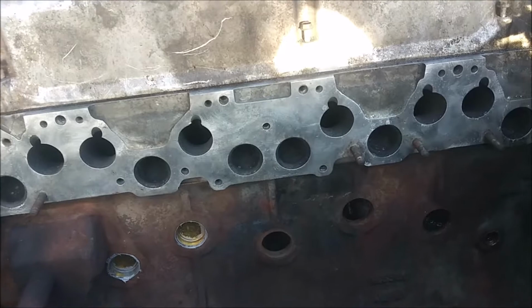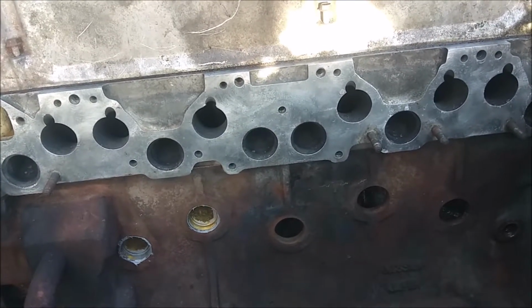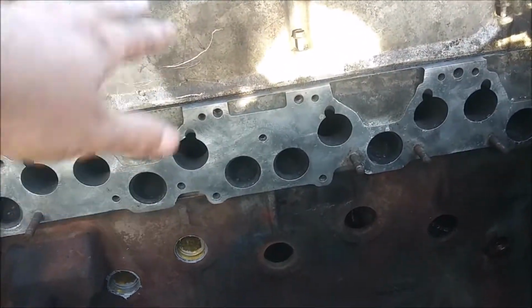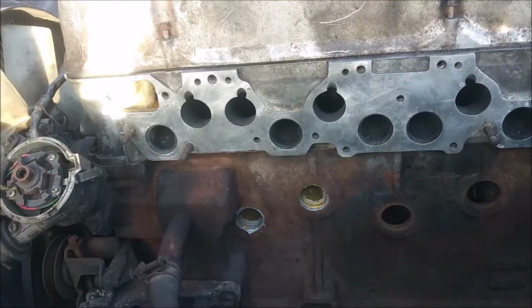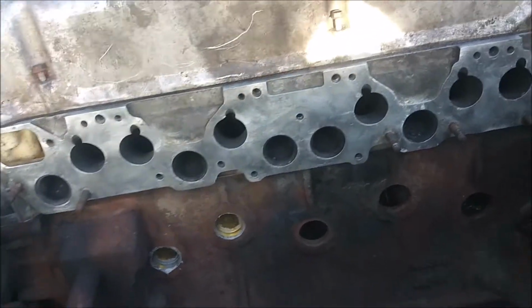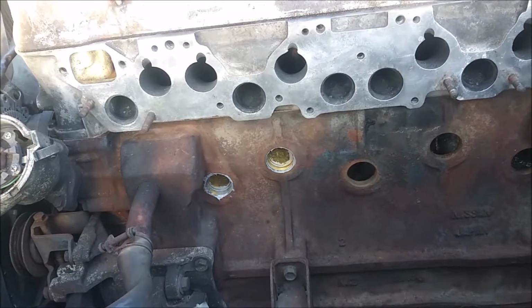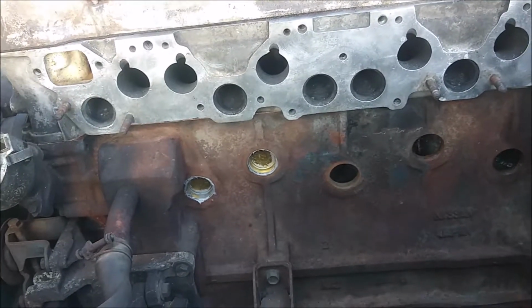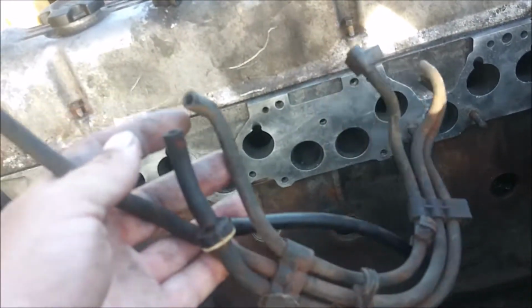So yeah, finish putting the other five caps back in, or plugs. Put the block plug back in, and get finished on putting the intake and stuff back on this engine. The intake, the thermostat housing, the exhaust, all the vacuum lines. Though I might research what I could bypass on the intake, because I don't have all the vacuum lines I need, and that's just a mess.